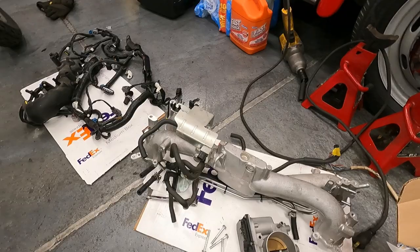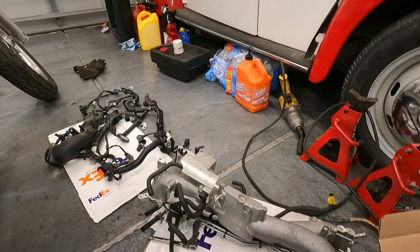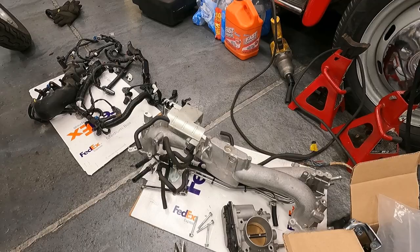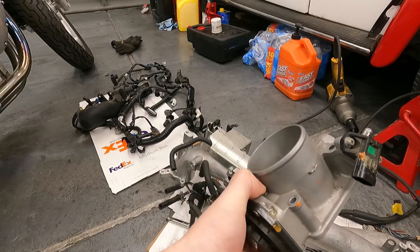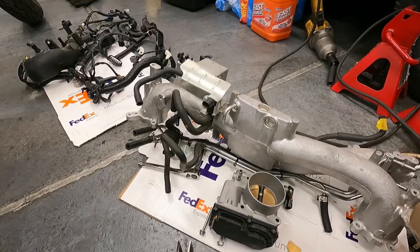Right now I will have way more options for injectors, and these ones start with already like a 500 cc, or 560, versus what I have right now in the motors, a 380 cc. The other advantage would be the throttle body. It's an electronic throttle body, which is actually really cool. But the Megasquirt itself doesn't support this.